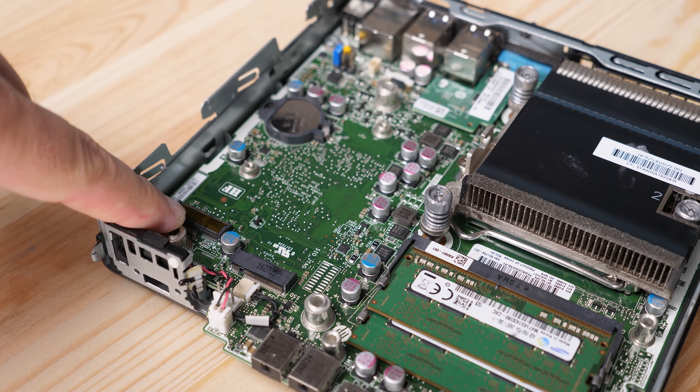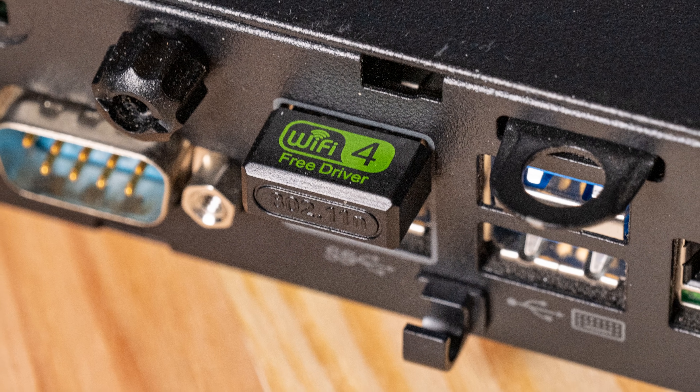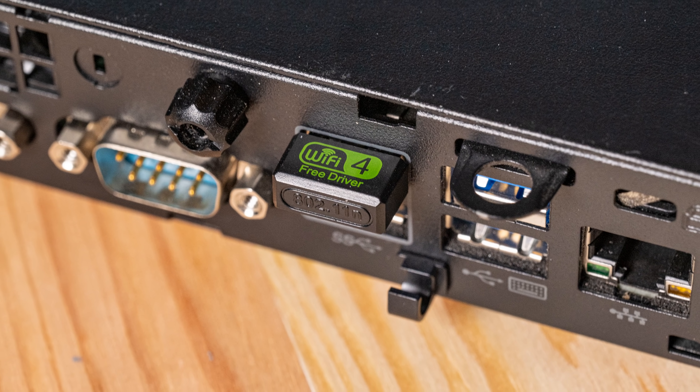To get access underneath the hard drive, there are four screws, and under there you'll find an M.2 slot for an NVMe SSD and a shorter M.2 slot for Wi-Fi. In this generation, if the system has internal Wi-Fi, the vast majority used 802.11 AC solutions with Bluetooth 4, but there was also an HP Wi-Fi solution that only had A/B/G/N — not AC and an older generation. Some systems even came with external USB Wi-Fi adapters that have poor range, so definitely look out for that.